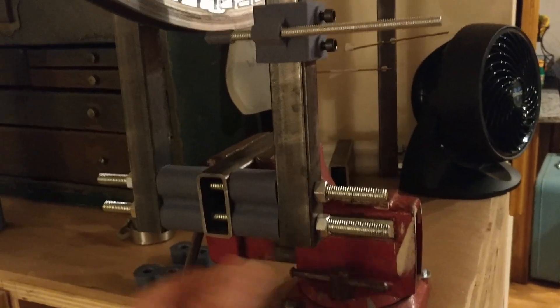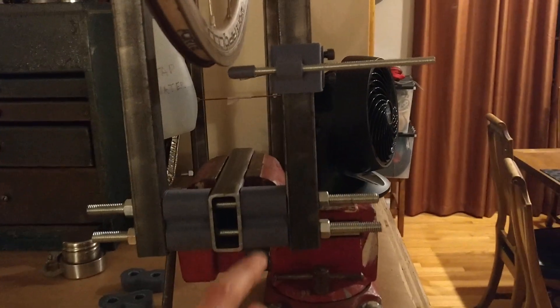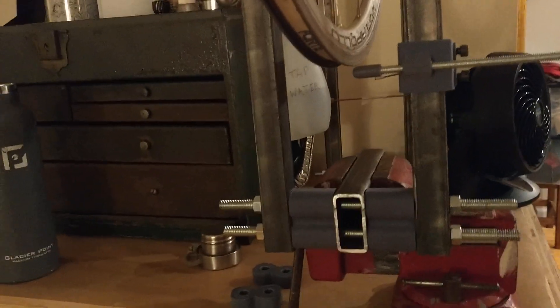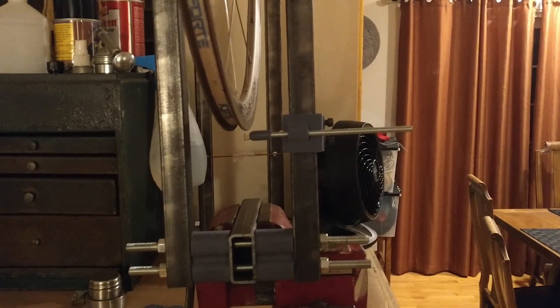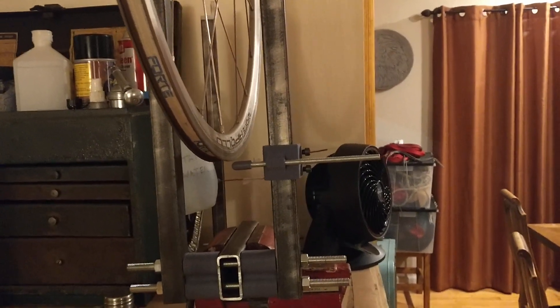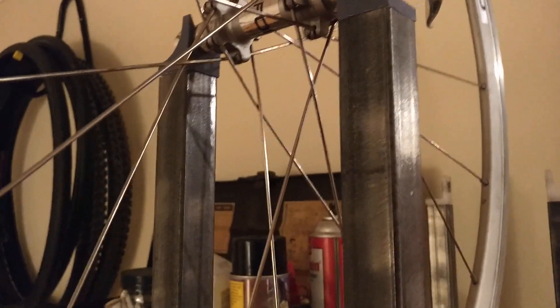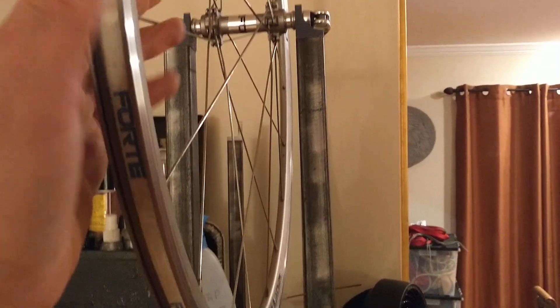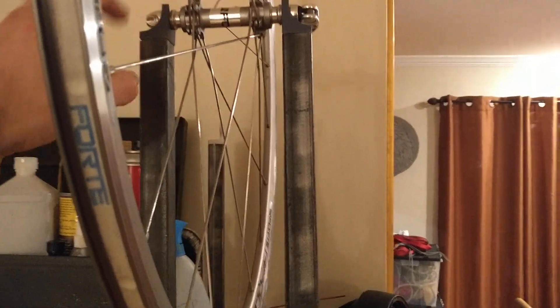If you don't have the vise to actually mount the whole thing in, just use the lumber and you can screw it from the bottom into a plywood base. Now if you don't have the drill to make these holes, well, that really is a personal problem — you should just go buy one. But buying a 3D printer is a much bigger investment and really not something everyone needs to do. Luckily, this design is simple enough that it really does not require a 3D printer. If you just use the 1x1 inch oak as your upright, you can put any scrap piece of metal here as a bracket — just a straight piece of metal screwed in the side — and then cut those v-notches with a hacksaw or a file. As long as they're roughly correct and they hold the wheel still in space, that's all that matters. The wheel just has to spin still in relation to this axis. It does not matter how pretty these v-notches are — it will work either way.